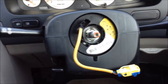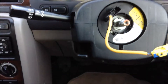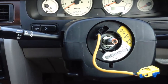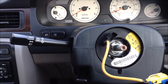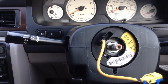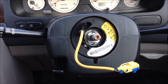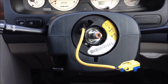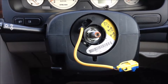With the wheel off, you can see this ring here — it carries the airbag wiring and also the horn and speaker wire. This ring can be removed and changed, though we haven't got one to change. You need to make sure it's in the straight-ahead position, aligned with the wheel, because it rotates with the steering wheel to carry the wiring — it's actually a spool of wire that winds and unwinds. If you have a permanent airbag warning light, or your volume up/down doesn't work and it's not the switch or radio connection, then this ring with the yellow label is likely the culprit.